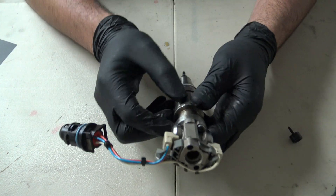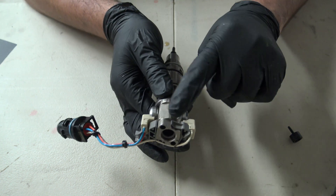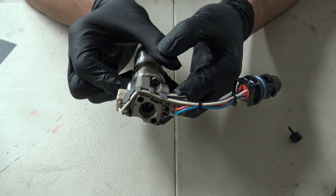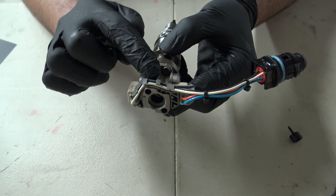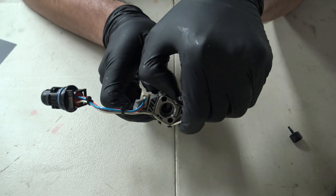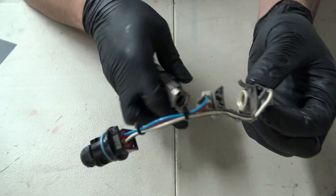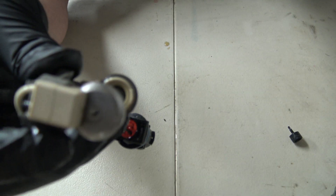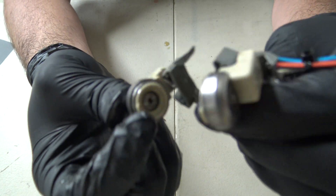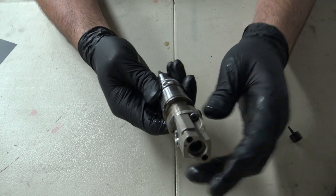The way I like to think about it: I consider the slope side the front, because when you take the coils off this is the open disconnected part — kind of like opening a book. The flat side I consider the back. You pop your coil off by lifting on the plastic tab, and the coil comes off kind of like earmuffs. While you have them out, take a look at your coils and make sure they're not burnt, because burnt coils can definitely cause injector issues.